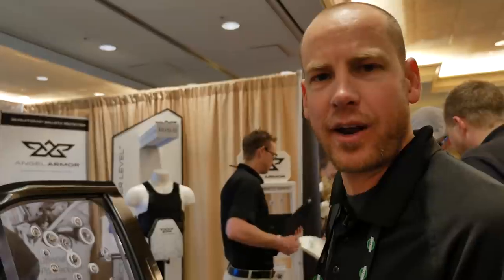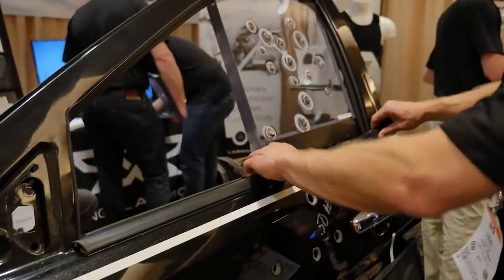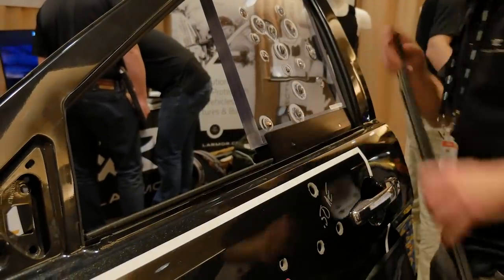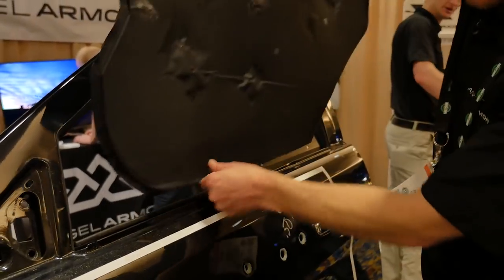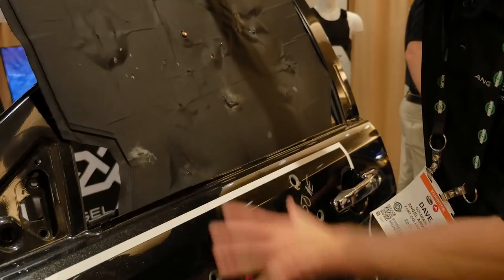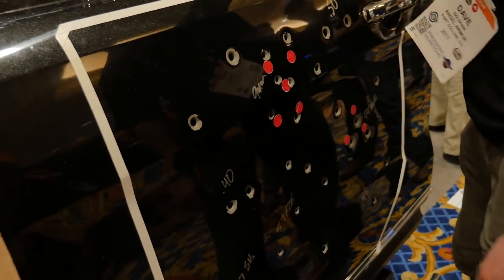So during a coffee break, he can get the protection that he needs. The way the quick installation works is you basically remove the weather strip here on the top, and this ballistic panel slides down into the gap. It would slide down into the door, move forward into position, and the weather stripping goes back on.